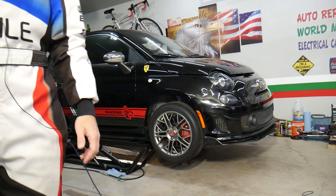Cause number five could be a loose wire. If the actuator or switch was replaced and not put in correctly, the wire can come loose from a bump or from hard driving, causing it to not work. Those are the top five reasons why a trunk liftgate doesn't open on a Fiat. Hopefully the video is helpful — thank you for watching, see you next time.